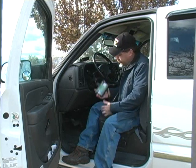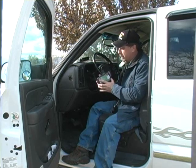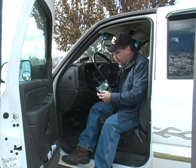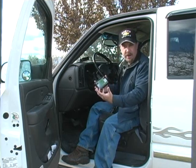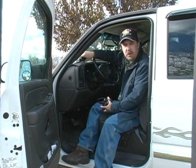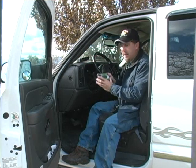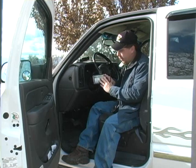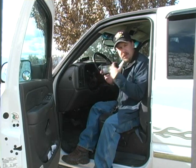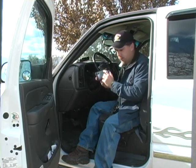What we're able to do now is we've got these custom built for us with our own software. When you order the Easy Tuner — by calling us or ordering online — we'll get your VIN number and your tire size, because a lot of guys upgrade to taller tires. We'll build a custom tune on a benchtop ECM with a wiring harness and our laptop, then plug the Easy Tuner into that ECM and offload the tune onto here. Not only do you have your Dura Mileage tune specifically for your truck, we also put a GM service updated stock tune on here too.